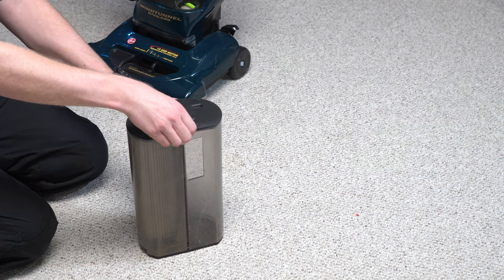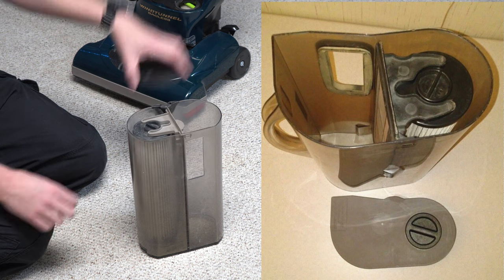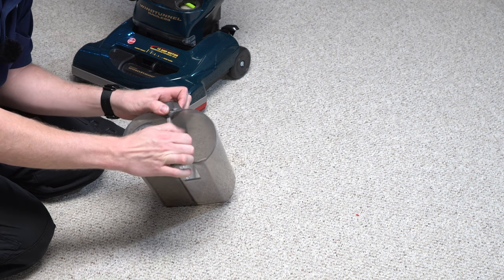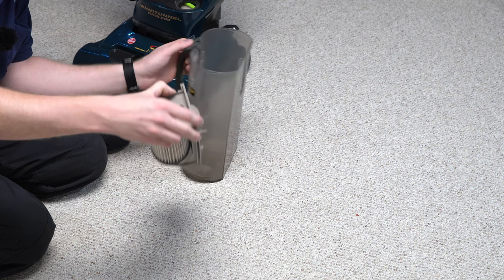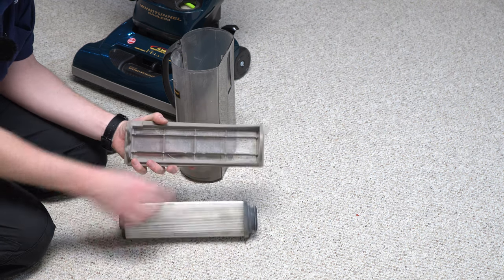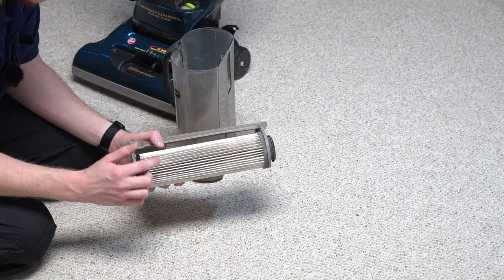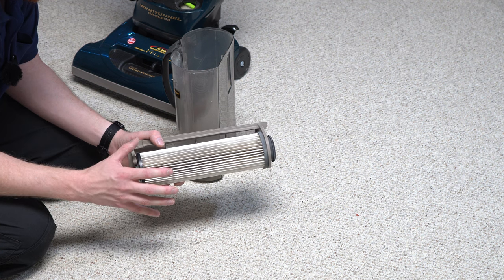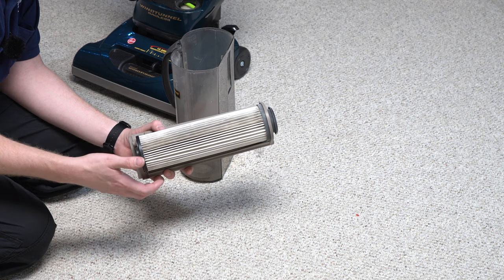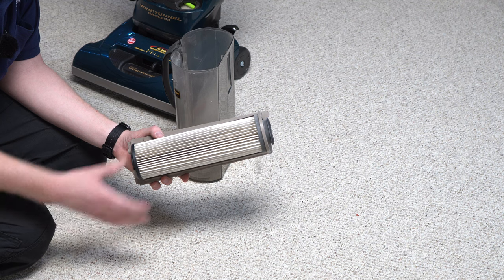First, you have a cup with a lid that you could lose. On some of the more deluxe models, there was a knob where you could turn the filter to shake itself off — this one doesn't have that. You have these knockers that interact with the filter. The filter was made from Teflon-infused paper and actually rinses clean really well. Even though it plugged up fast, it was easy to clean, and only needed replacing about every six months — which at the time, compared to Eurekas that needed new filters almost every use, was actually an advancement.